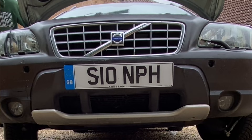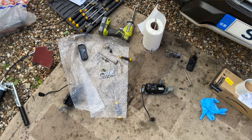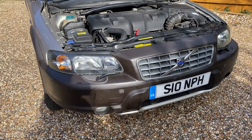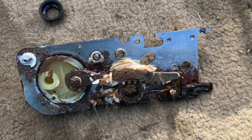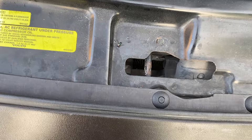I also repaired the headlight wipers, which now work — woohoo! That was a massive job; I needed to take off the entire front bumper structure. I managed to recondition one of my own motors and the other I had to buy a replacement and recondition that too, because they fail really badly as the cogs inside seize up. When I took the bumper off I broke all the clips, but for £2.99 on eBay I got new ones.